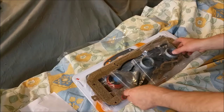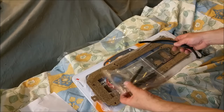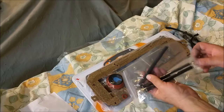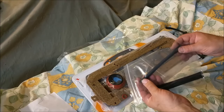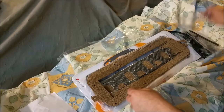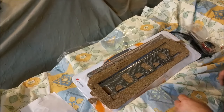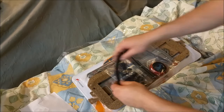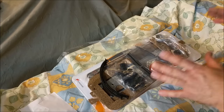The first thing we do is open up our gasket set. We've got all the exhausts and manifold end pieces there, valve stem seals, sump gasket - oh, that's not good. They're the rope-type rear mains. I'm not using those. Normally these sets are supplied with two rope ones and two rigid ones, and I like the rigid ones because when you first put rope seals in, they hang on to the crank and you can't feel it turning freely. So I'm not using those. Timing cover seal, fuel pump, oil pump - I don't think the rigid ones are here. Well, that stops me today because I'm not using the rope type - I hate them. The other ones just give so much more feel; the crankshaft will rotate nicely and you can feel if there's any binding. We need to be able to feel that.